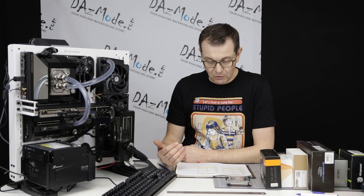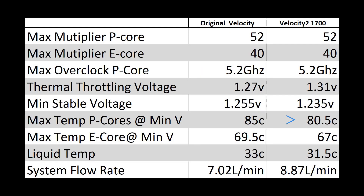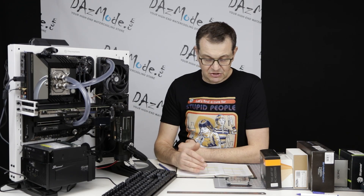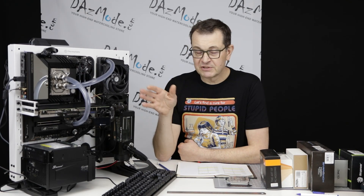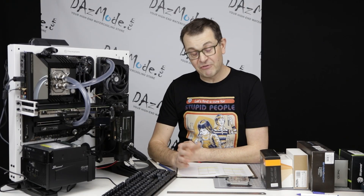Because of the lower voltage, I also got lower temperatures. At the end of the day, Velocity 2 won for me because I can achieve the same overclock at lower voltages, and subsequently lower system temperatures. For the P cores, I went as much as five degrees down — the difference between running slightly higher voltage with the original block versus this one. Five degrees, I'll take. For the E cores, the workload was much less since the multiplier was 40 in both cases. The difference between E cores across the blocks was literally just one or two degrees, which I consider within margin of error.